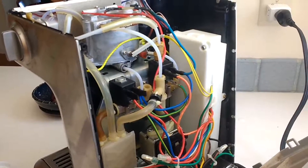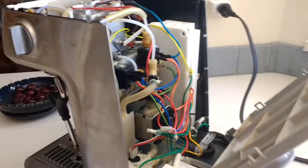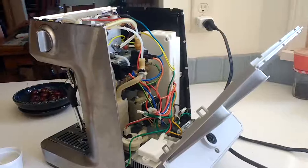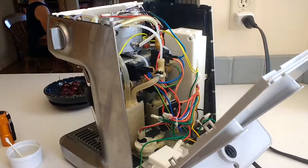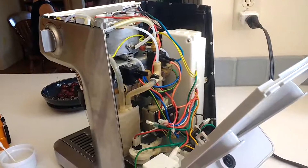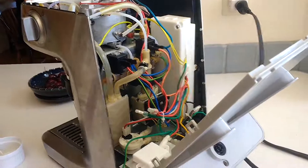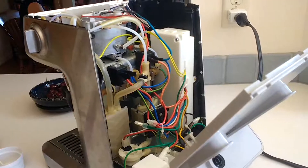So, I'm real pleased that this one may be given a new lease on life. It's the Breville infuser. Water stopped flowing from the brew head. Kept flowing from the water dispenser and the steam wand. And, the fix seemed to be soaking those valves in vinegar. I didn't have any actual descaler. The vinegar worked for me overnight. So, there you go. Good luck with your project. Over and out from British Columbia.